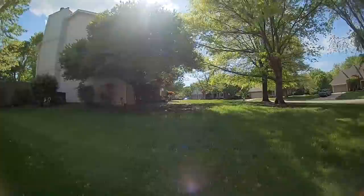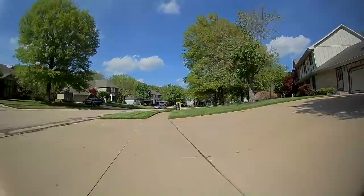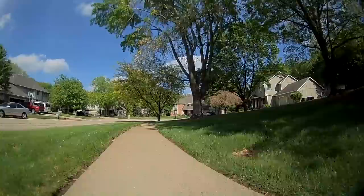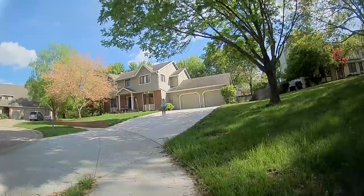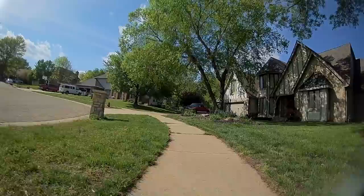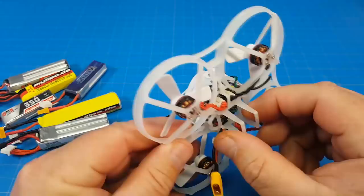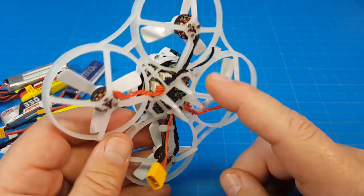You can probably tell that she does not take dance. We take off and fly around, and you'll see that this footage is actually with those King Kong 48 millimeter props and we have a little bit more jello or vibrations in my opinion. There are some additional props you can try, although I will caution you they are press-on props and these motors come with 1.5 millimeter shafts — they are very difficult to get on and get them down in the duct area. My fingers got seriously sore trying to get those props back off. A prop remover really didn't help in the case of removing those 48 millimeter props. This is the same battery tray dimensions we've seen time and time again, and I'm starting to wonder if they've created this tray to limit our battery size to help us stay underneath that amp draw.